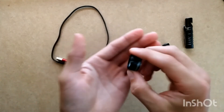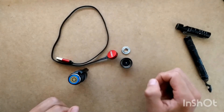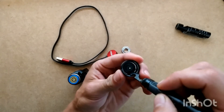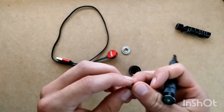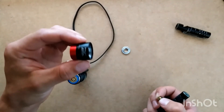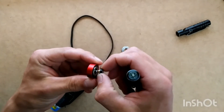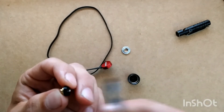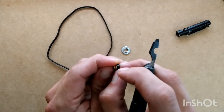Just like that. Then you're going to turn it over and it's going to fall out like that. Remember how this goes — it goes in just like that right there. Now what you're going to do is remove this inside here. You can see that little pinhead-size thing right there, and you're just going to pry it over like that. This is actually what connects to your charging device. So when you connect it to the base here — magnetic — in the center is this piece which I just removed, which connects right there in the center. The spring inside here is broken, causing it not to connect while charging.